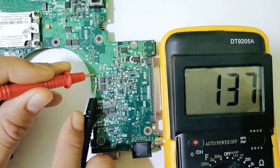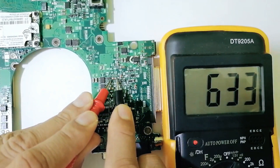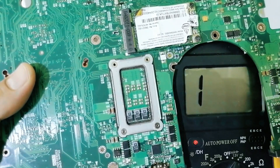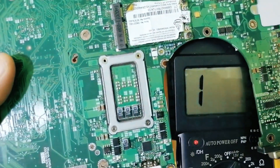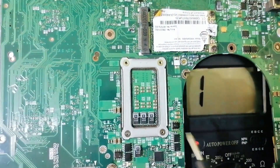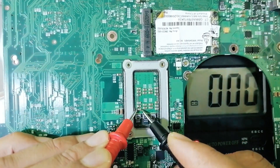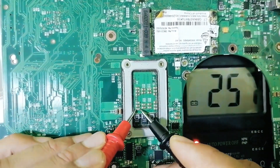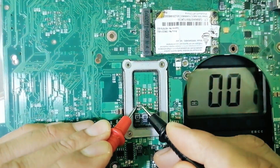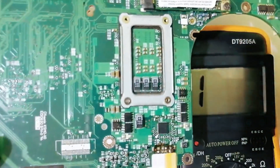As you can see here, a normal reading. But I want to add an exception: this is actually a faulty motherboard where the short is in the CPU circuit. With the CPU installed, if I check these ceramic capacitors, you can see we get zero in the multimeter — that is a short. Let's check another one — zero again. That is a short circuit. Let's remove the CPU.